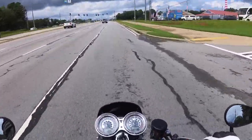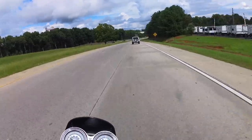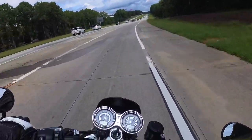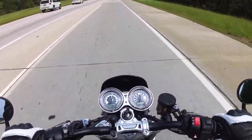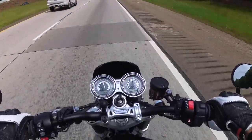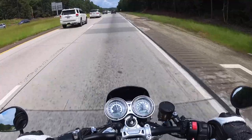The forks on this are non-adjustable, but they've got good damping - they actually did a good job on the refresh for the new model. So one of the things I'm trying to figure out about the map for this bike - it's pulling really good, it's very smooth, I don't feel those flat spots. That more aggressive throttle - it's snappy, it's good. I might tone it down a little bit under 5%, but maybe I'll just adapt to it. It reset adaptives, so it's probably going to go through a little bit of an adjustment phase as it learns my riding.